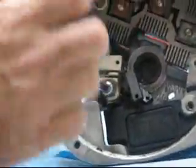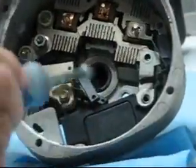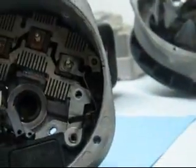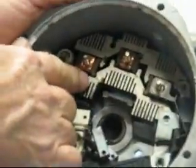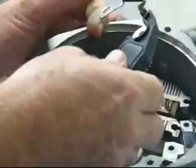Continue to take the brush holder assembly out and keep track of your springs as they pop out — you want to know where those go if you're going to use them again or if you're doing a complete rebuild. This one we're going to reuse the brushes because you can see they are very long. This is a situation where the bridge rectifier went bad. The bridge rectifier is the assembly with diodes in it that converts AC current to DC current, and it's the number one component that goes bad in alternators — it needs to be replaced commonly. Now we're able to take the voltage regulator and brush holder assembly out of the alternator. The brush holder assembly plugs into the voltage regulator and there's also a stator lead that comes off of here.